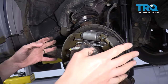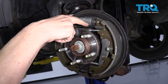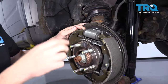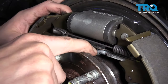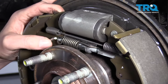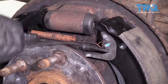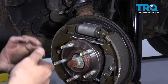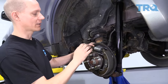Most of the time you are replacing the brake shoes, the brake drum, or both. When you do this job you'll find a few things to replace or inspect. One thing that is almost always a problem is the adjuster — found on just about every brake drum, sometimes at the top, sometimes at the bottom. These things rust up and get stuck, so you have to remove the adjuster, take it apart, grease it really well, put some anti-seize on it, and put it back so it works properly.